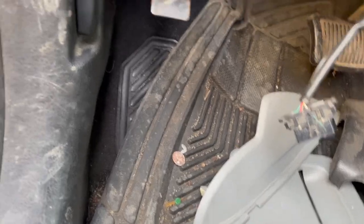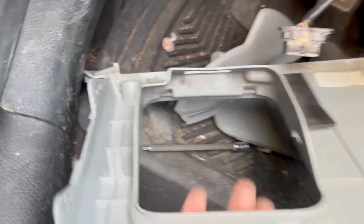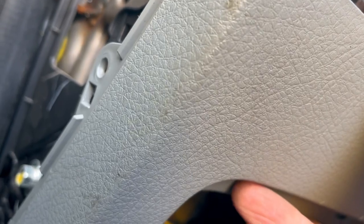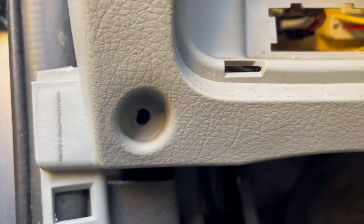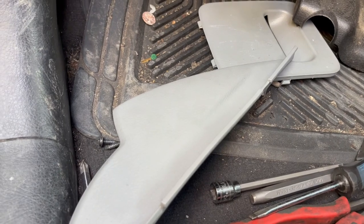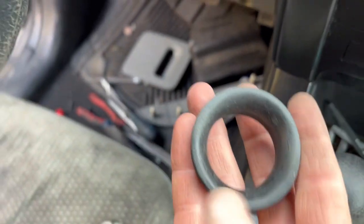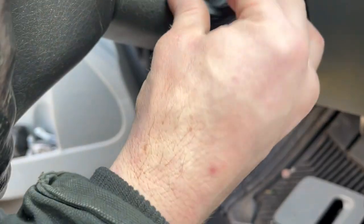The DLC connector just pops right in there — there are just little tabs. You grab that and it pops right in. This piece goes up here and that's where the little screws hold it on. There's one Phillips there, one there, and two right here. You won't be able to see those without taking this little side panel off — it just pops right off. That's the fuse cover, and there's the top shroud which just snaps in with no screws.